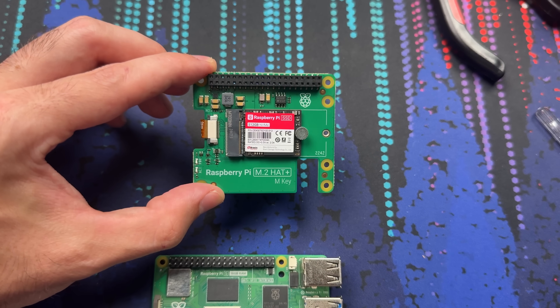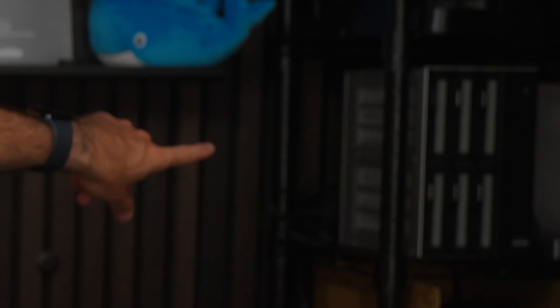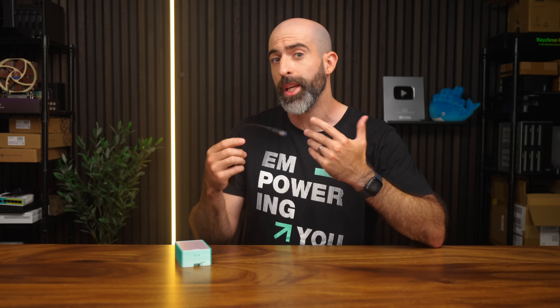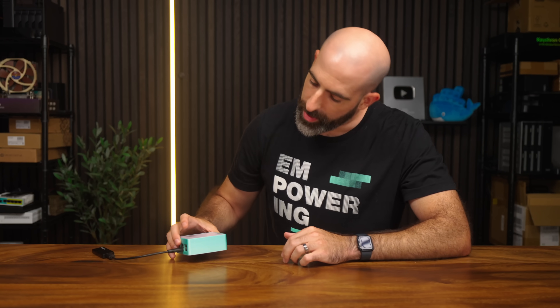Right now we only have a 512 gigabyte NVMe drive, which isn't much, and we don't really have space to add more. So we're going to utilize a DAS, or Direct Attach Storage — a secondary piece of hardware containing one or more drives that attaches directly to the host machine, usually over USB. I've got a Terramaster DAS that I've used in the past; a single USB-C connection gives me access to six hard drives. You'll be limited by USB speed, but for most systems that's at least 5 gigabit per second, which for hard drives isn't terrible. I'm just going to use one of these generic external SSDs to keep complexity and power usage down, and plug it into one of the USB slots.